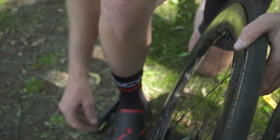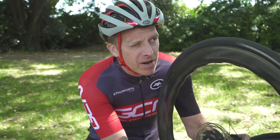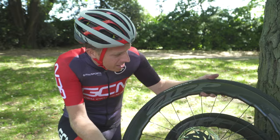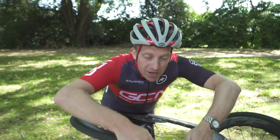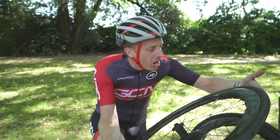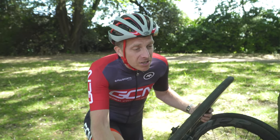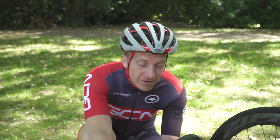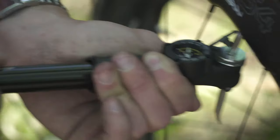Once you have put a decent amount of pressure into the tyre — normally around 40 or 50 psi — have a look to make sure the tyre is seated onto the rim correctly. An easy way to do that is to use the sidewall as an indicator: it should look the same all the way around, just above the braking surface or edge of the rim. If it's not, you can simply wrestle it into position with your thumbs, wiggling it to allow it to pop into the right place. At home with a track pump it will just find its natural position, but out on the road just do it as a precaution. Once you're happy the tyre is perfectly seated, reinflate to your desired pressure before putting the wheel back in the bike.